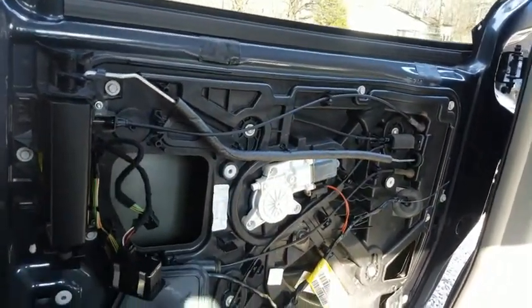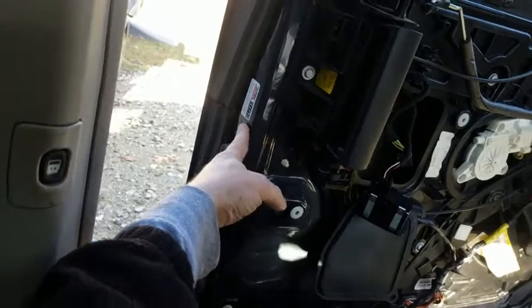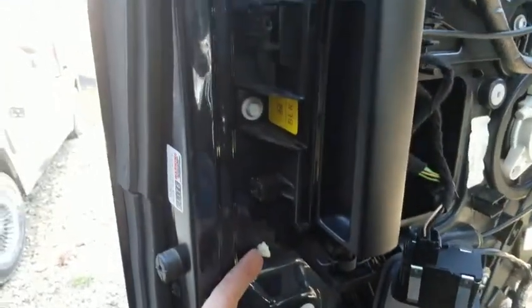Once you get the bar up in there, start the top bolt in the window track first before any other ones. Once that one is lined up, do the rest. Then the other bolt here, and the three bolts in the back from the back edge against the latch go in last - you can kind of pull that into place. Then put the panel back on with all 10 bolts around the outside. Feed the cable back in, the front latch assembly just sits down in there and you bolt it with the three bolts, then push the cable holders back in from the inside.